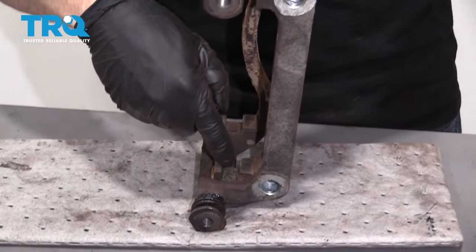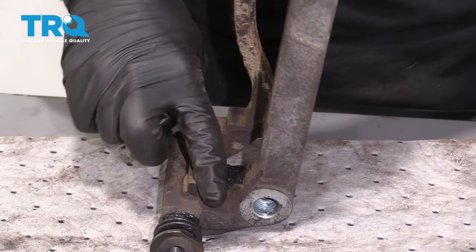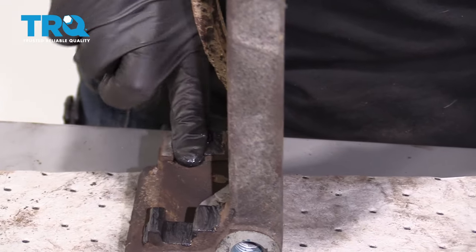Let's go a little bit more grease on this and slide it in here. Make sure you also get grease up onto this lip. There's plenty on there — give it another little twist. We're going to do the same to the other side. Now we're going to move along to putting a little bit more of that caliper grease right up along the areas we just cleaned off.